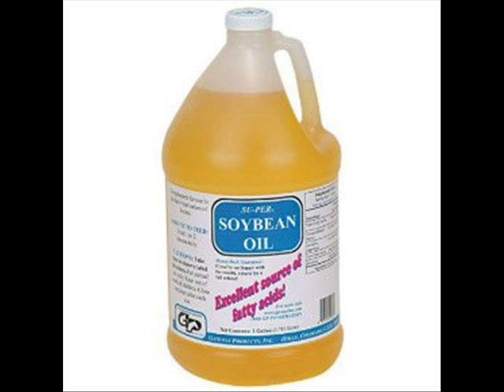The other thing you could use is cooking oil — yeah, the stuff most people have in their home. In a pinch, you could use this. Cooking oil actually has some advantages as a lubricant. For many years, people have been taking used old cooking oil, filtering it out, and using it in lawn mowers with very few ill effects. Cooking oil has better anti-wear properties and a higher resistance to breakdown at high temperatures. One fun advantage: it will actually change the exhaust smell of your engine to something like a deep fryer or a barbecue. In fact, a lot of the biodegradable two-cycle oils on the market nowadays are made mostly out of canola oil, which is basically an offshoot of rapeseed oil — a material that has been used to lubricate machines for years.